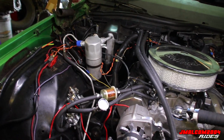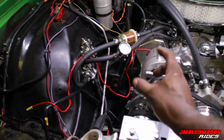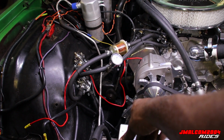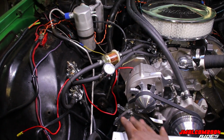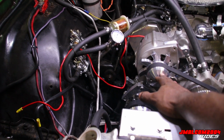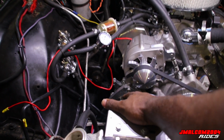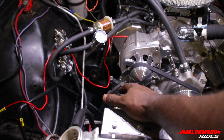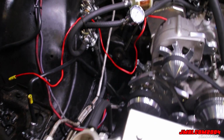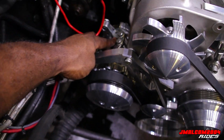I know it's a dash 8 and a dash 6 on the compressor. I gotta show y'all that piece you have to buy when you get the compressor, man. That thing is $88. I try to tell y'all the cost. When you get that kit, you want this same setup. This kit is $775, I think. I kept everything March, but you can get a Sanden 7176 style compressor, it'll work. But that March compressor, 306, then the piece to go to it, so you can screw your lines on, is $88. It goes right there.